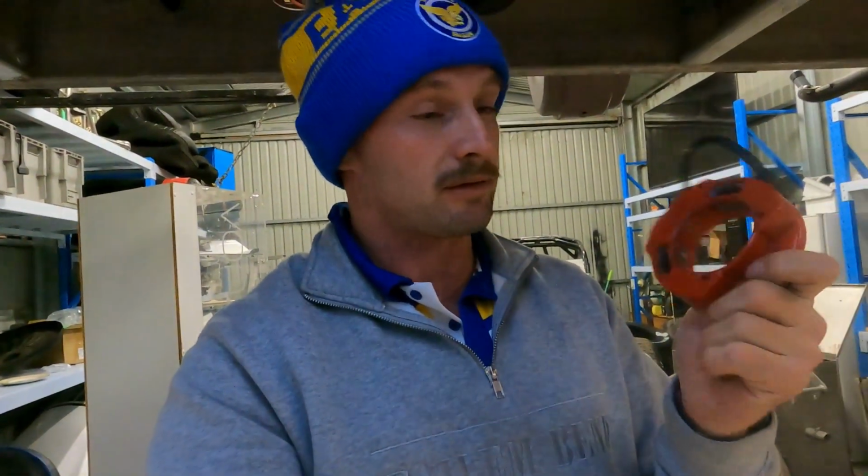So I came out here this morning before football to make sure everything was good and running right, and the bike wouldn't start. So I tested the spark plug, no spark, changed the spark plug because it's a new one, still no spark, changed the coil, still no spark, and then took a magneto out of my other engine and had spark and started fine and ran great. So yeah, a little bit disappointed because this one looks pretty new and they're pretty expensive, so that's a bummer. Oh well, bike's running now,